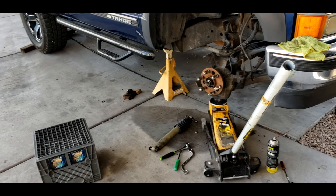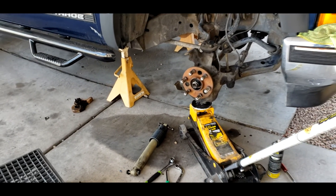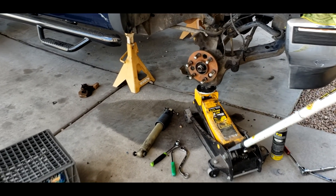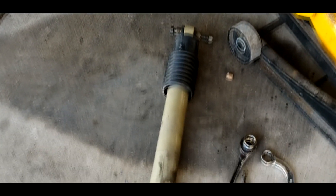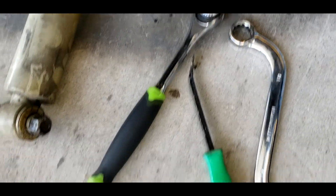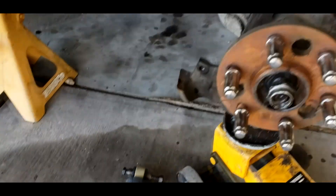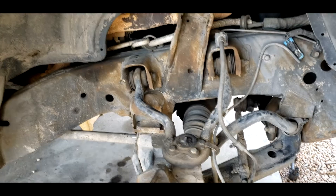I had to break out two more things. I had to get the floor jack out so I can put it under the spindle, lift it up just a few millimeters to get the tension off the suspension to make it easier to get the shock out. The shock did come out — I did have to get a little pry bar for a little bit of persuasion. Shock's out and I put the bolts through the shock so I can keep track of them later.